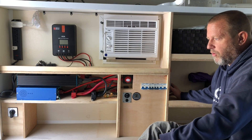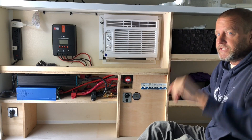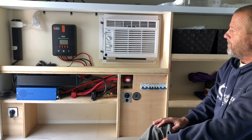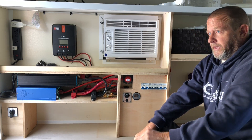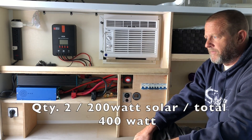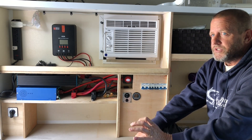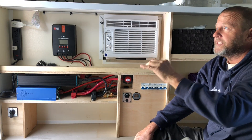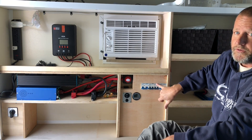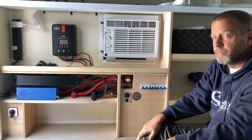We have an outlet for our Alpi Cool refrigerator, USB ports, and LED lights inside and on the outside of the camper. Our next step is the 200 watt Rich Solar solar panels — we're going to unbox those and get them installed on the roof. Those are the last two sets of wires I need to install. I'm going to run them in series, come through here, and run through the 16 amp breaker. All I have to do is hook up two wires to this breaker and this project will be complete.